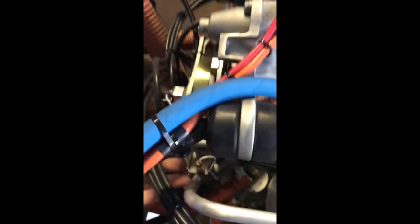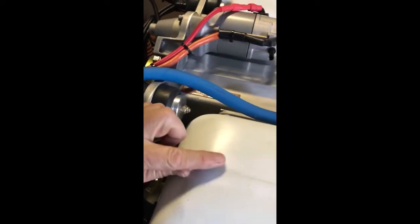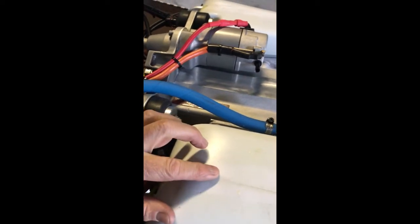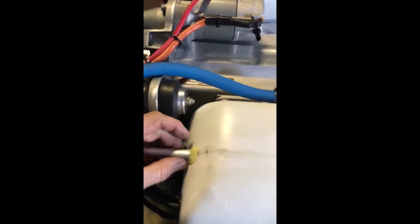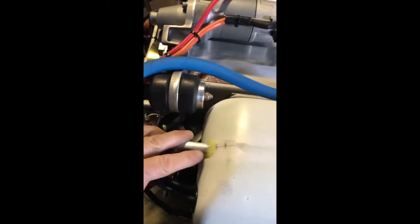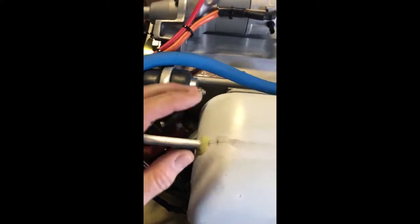The cooler tube which goes to your magnetos or the coil has to be all glued in place. On the inside I had to build a bit of a mount for the tube to rest on, and then — I call it camel snot — but it's a mix of epoxy and micro balloons, which is part of my aeromodelling background. I mixed all those up to get them all nicely positioned in there.